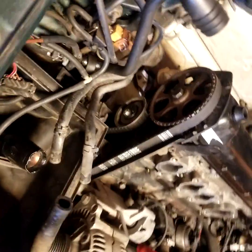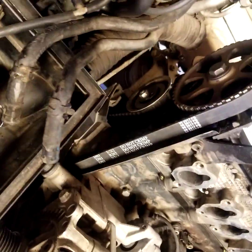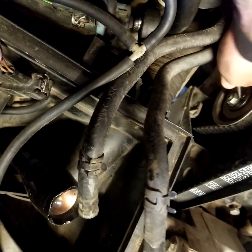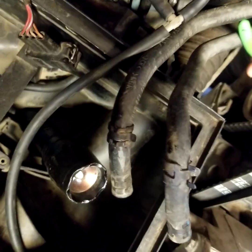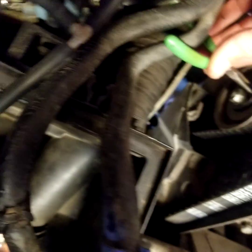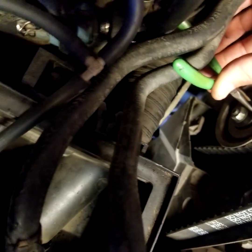I'm still going to fill the oil and get everything set up and running — I'll make a video after it's running. For this tensioner down here, you don't even really need a special tool. A small pair of needle-nose pliers will fit right into these little holes — they're like four millimeter or something. You spin it to the right — righty tighty lefty loosey — then tighten your nut up here, get all the slack out of the belt, and you're done.